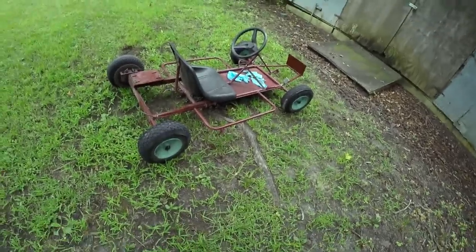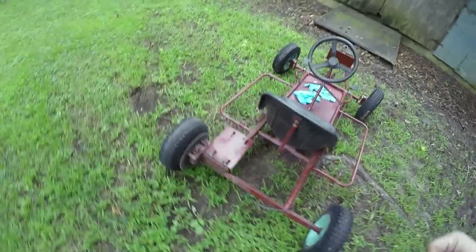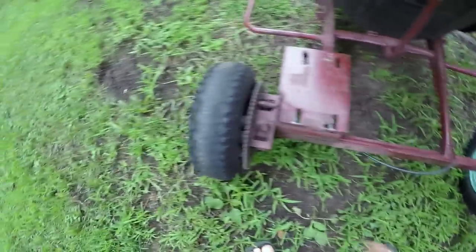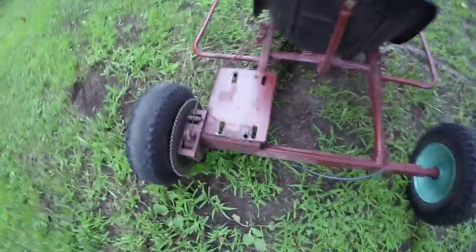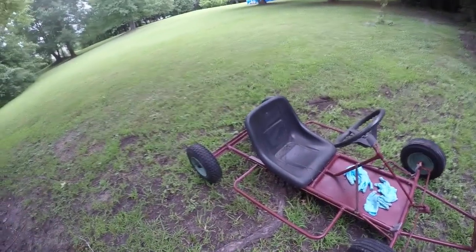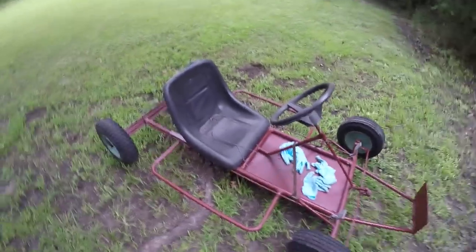Here she goes — bam, it's mint! Just to refresh everybody's memory: this is the go-kart we picked up for $50. It's one-wheel drive — no live axle, these two wheels are not connected. Engine goes there, there's the sprocket, clutch goes here, chain there. It's got a drum brake — very basic, brakes are pretty terrible. The seat is pretty much broken, courtesy of Taylor. With a six-and-a-half horsepower engine it should do around 30 miles an hour with the governor on.